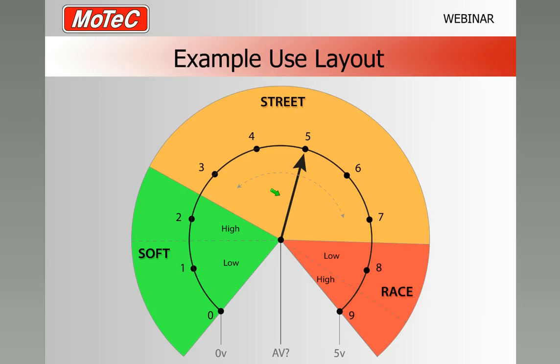We'll initially set this channel up for boost control — five different levels of boost — but you'll also see we can do other things with fuel and ignition at the same time. When you put race fuel in and go to the track, you don't need a laptop. Many people aren't laptop savvy. They just flick it to position 8 for warm-up on the racetrack, and on the last race flick it to position 9 for maximum boost, maximum aggressive ignition, and maximum aggressive fueling. It's up to you as the tuner to determine what each position does.